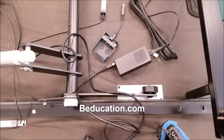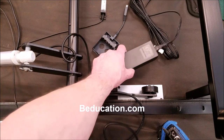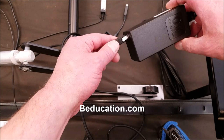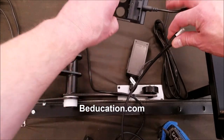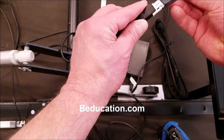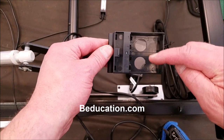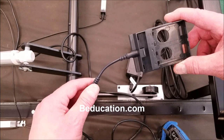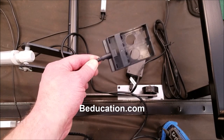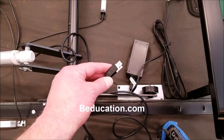In the unlikely event that you do lose power at your home and your power base is in the upright position with the head and the foot elevated and you want to bring it down to the flat position, Leggett and Platt has an option with this very simple battery backup system. Here's your power supply attached to the brain of the base — there's a little white clip right here. You depress this tab and pull it away from the power unit. Then your battery backup system clips right into place. You'd put two 9-volt batteries into the unit — this will give you enough juice to get the power base down, which will pretty much use up everything in those 9-volt batteries. But at least you can get back to the flat position until the power comes back on. When that's all done, you use the quick disconnect clip, put the power supply back on, and you'll be ready to go once power returns.